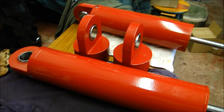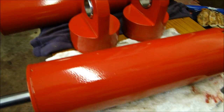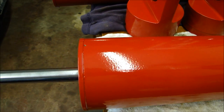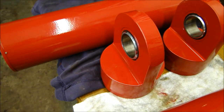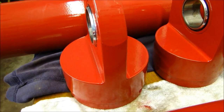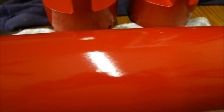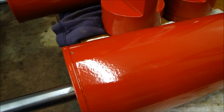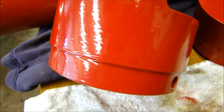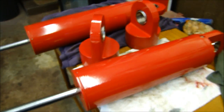Here's what the finished epoxy looks like — it's very shiny. This color happens to be RAL 3002 Red. There are a couple of advantages to painting with epoxy: number one, since you mix it two parts, it's going to dry very hard and be very durable. Number two, it takes a little longer to dry than regular paint, so it flows and is a lot smoother and shinier than trying to work a clear. The reason there's a little orange peel is because the metal etching primer underneath had to be put on extremely thick, but the paint itself is very shiny and it's a beautiful material.